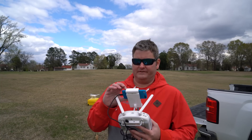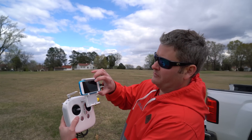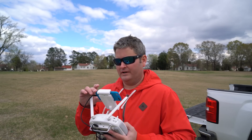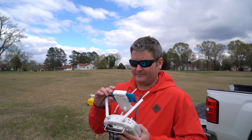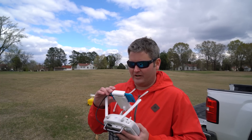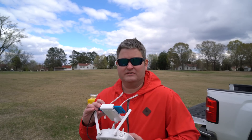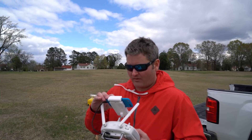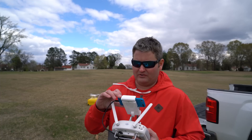To ensure it was on, in your app there's a little icon that looks like a controller toward the right where it says 'Safe to Fly GPS' in the middle. Click that controller icon, and on mine it's the second one down. It says visual navigation system — turn on forward obstacle sensing system. When forward obstacle sensors detect an obstacle, the aircraft will slow to a stop. Maximum speed using obstacle sensing is 22 miles per hour, or 32–35 kilometers per hour. So I've got forward obstacle avoidance sensing on.